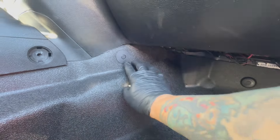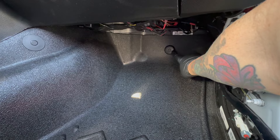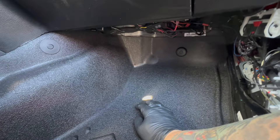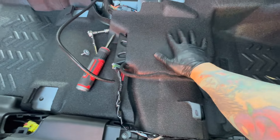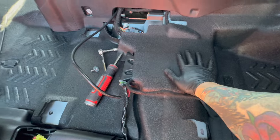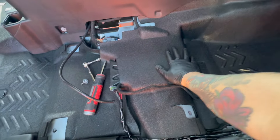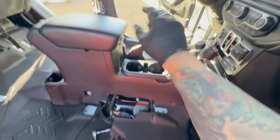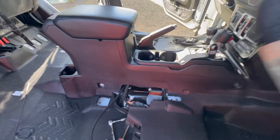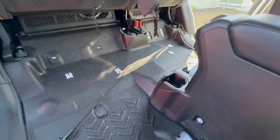I was missing a couple of grommets across both my kits, which was disappointing. They also don't provide the elevated grommets. There's an elevated grommet here, a regular grommet here, a regular grommet under this one — and that's on your passenger mat. The back mat doesn't have any grommets at all — that hole is for mounting your jack. The best install order I found: put grommets in, install the passenger mat, then the back mat, then fold up and install the driver side last.